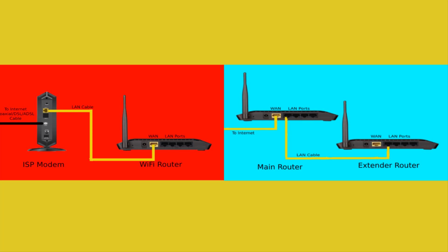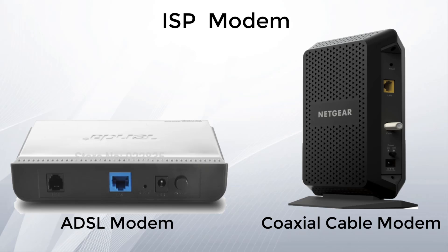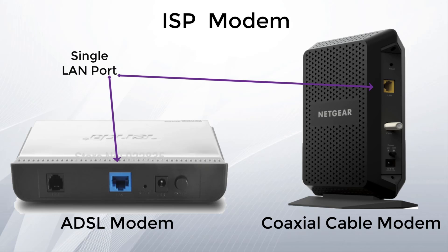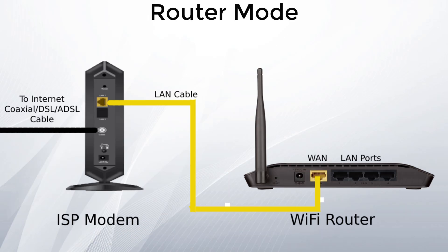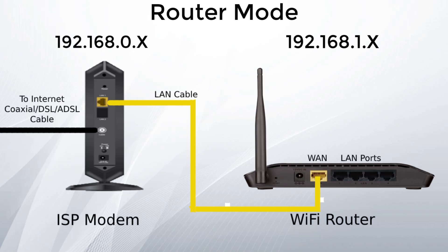You can connect two routers using two different modes: first, Router mode; second, Access Point mode. Router mode is mainly used when you have a DSL cable modem provided by your ISP. Sometimes the ISP provides a basic modem with only one LAN port and no wireless functionality, so you can connect only one device to access the internet and can't share it with others. In this scenario, use Router mode and connect your Wi-Fi router to the ISP modem using a LAN cable to share internet via the router's LAN ports and built-in Wi-Fi. In this mode, two different subnets will be created and both routers have their own DHCP server.